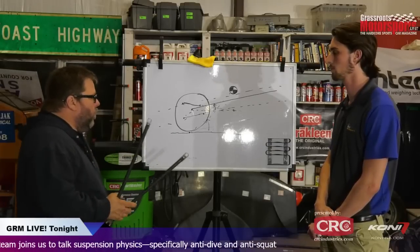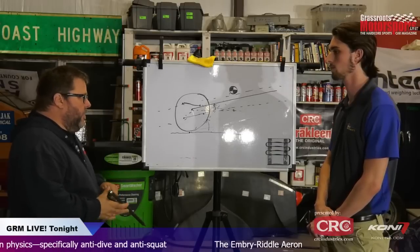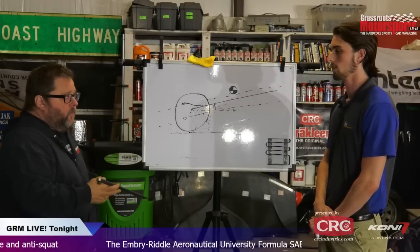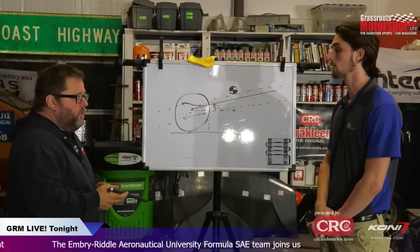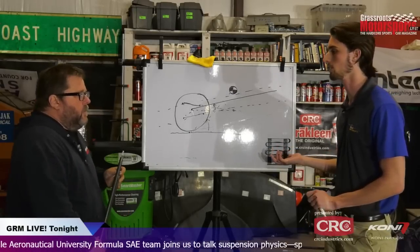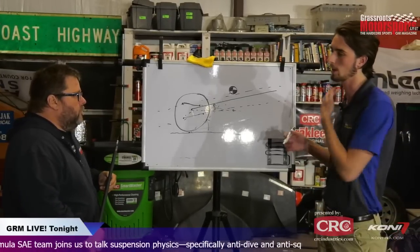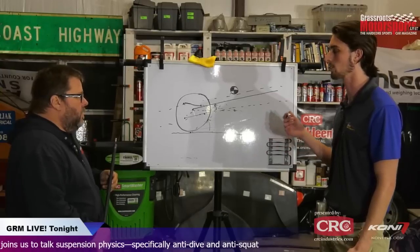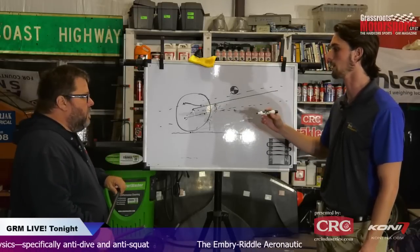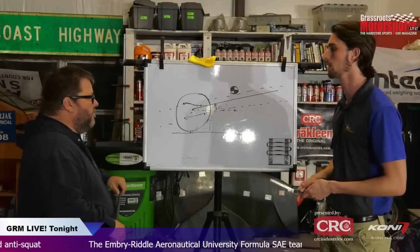Okay. So when you have parallels, what other advantages are there, maybe in something like camber gain throughout travel? Are there other advantages there? I would think with a parallel one, you wouldn't get much toe change at all either, would you? Yeah, so that's another advantage of the parallel, it's a little easier to deal with the toe change. And essentially the toe change, you can pretty much dial out with either method. It's just a concept of aligning your tie rod or toe link in plane with the way that the arms are rotating. I could draw a front view of the roll centers if you want to get into that.